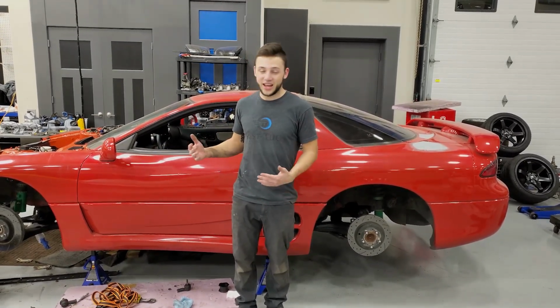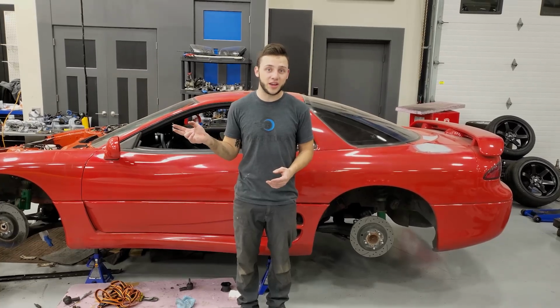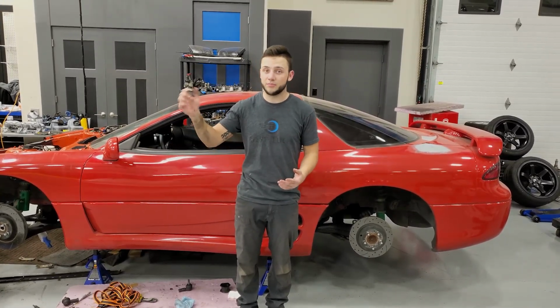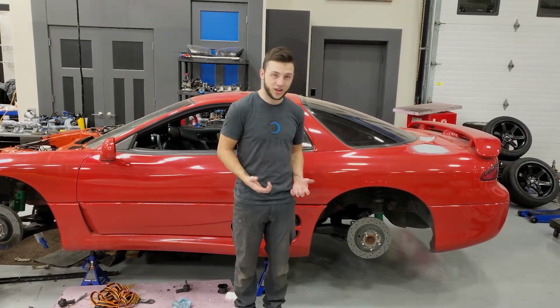So I went ahead and went with that because the front wheel drive steering rack doesn't have the two ports for the all-wheel steering, and since I deleted that, I don't need those ports, I don't need the plugs, and that's one less leaking point. So I just went with that, and it's new, it's nice, we're good.